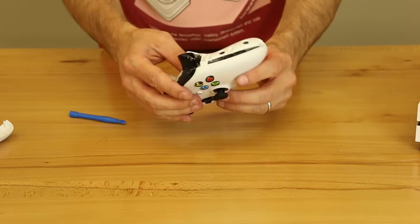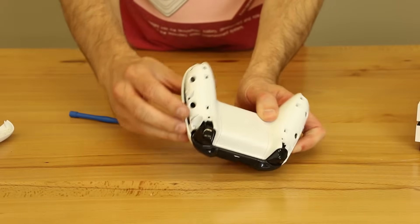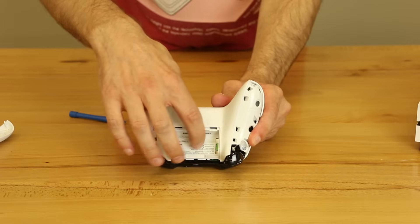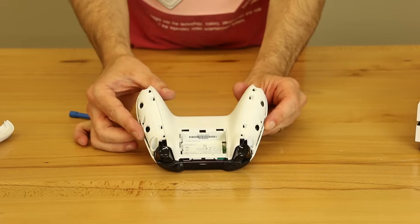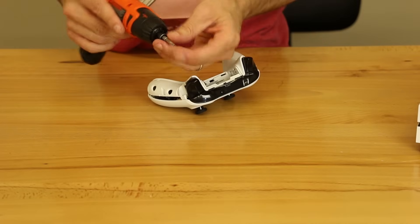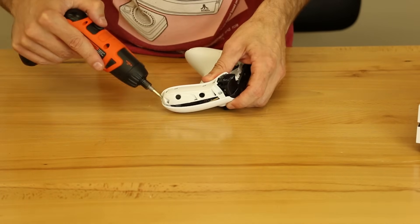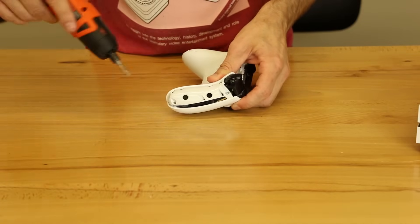So the next thing we've got to do is remove this screw, this screw, this screw, and this screw. And they also hide one in the battery compartment right under the label here. Assuming this is the same as the Xbox One, which so far it looks pretty similar. The bit I usually use for this is a T9 — it actually needs to be the security Torx, so it's basically a Torx with a hole in the middle of it to fit the security screws. So those ones.